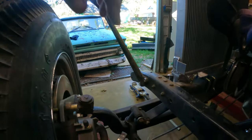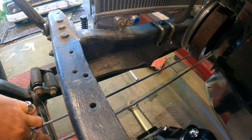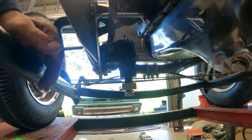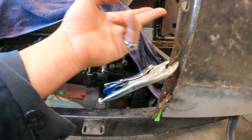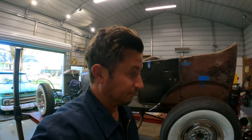But what we did get correct is with our lineup of trying to be parallel with our tie rod, we're pretty near close to being centered. Obviously, I just have two pieces of rod because my stuff is in the mail. You can see I got about 3/4 of an inch there, and this is where the steering joints need to come through. So they'll need to run somewhere back this way along the frame and then turn up to our steering column.